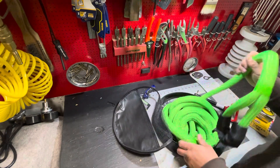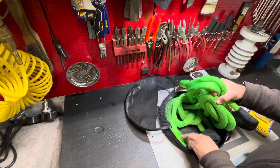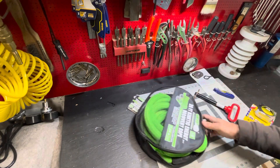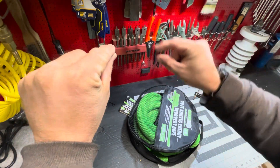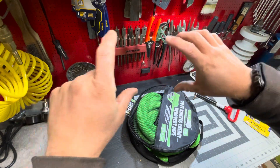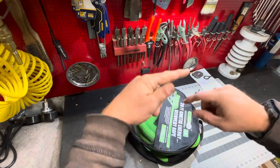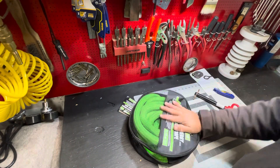I did see some terrible things — if you hook one of these to an actual trailer hitch ball, that's a recipe for somebody going to the morgue. A lot of people have drop hitches, but when you put a load from that focal point it increases the dynamic situation. You put too much on that, it breaks, and then you've got this dynamic stretchy rope going about 180 miles an hour — right through your back window or your windshield.